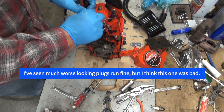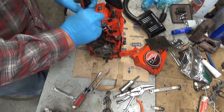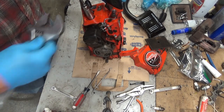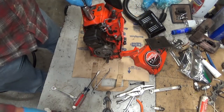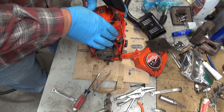Originally, the Super 2s didn't use a projected tip either, and later on they started using one, and I'll be honest, I still stick with the non-projected. It just gives you that clearance to the piston, and again, I have personally never noticed any runnability issues. I'm sure somebody out there will say that there are some. Yeah, maybe it's true, but not that I've noticed. All right.